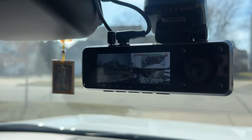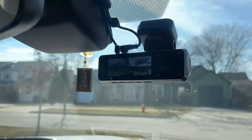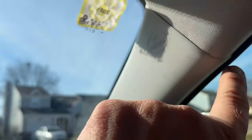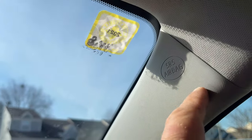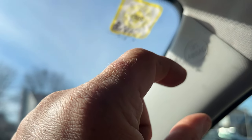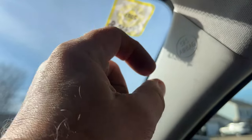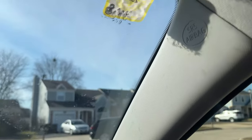The rear camera works. The setup is complete. The installation is pretty straightforward — the only difficulty you'll encounter is around the corners and the grommet in the back. If this panel comes out, don't panic — you need needle nose pliers and there are two little pins. Squeeze it and you can pull the panel out. Everything looks very nice.